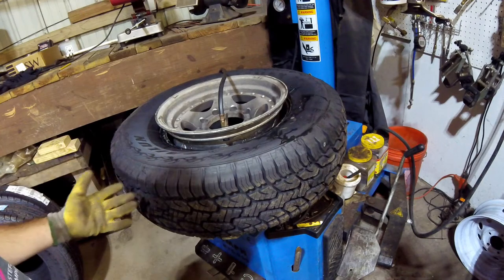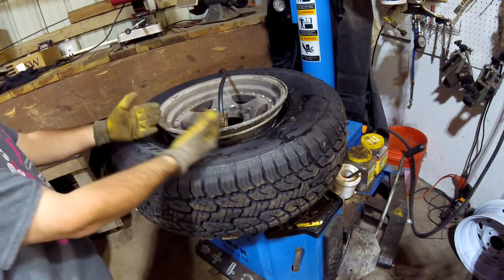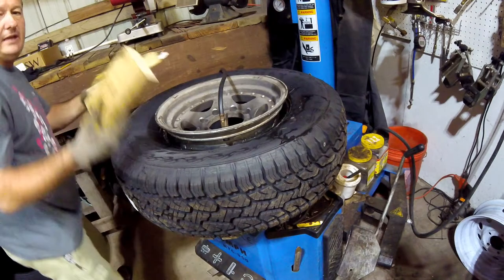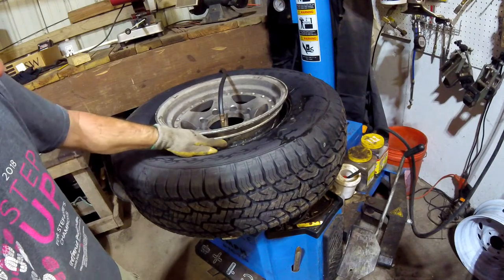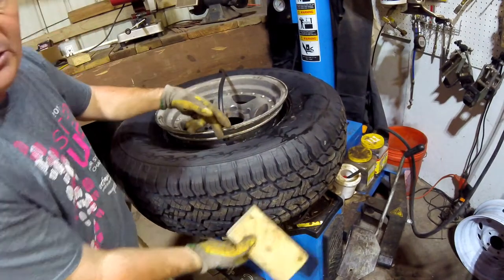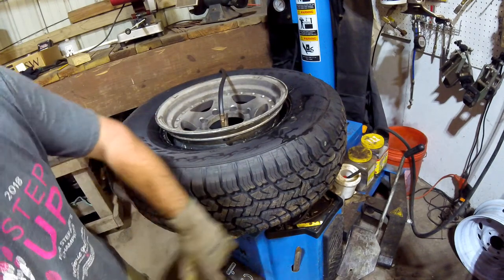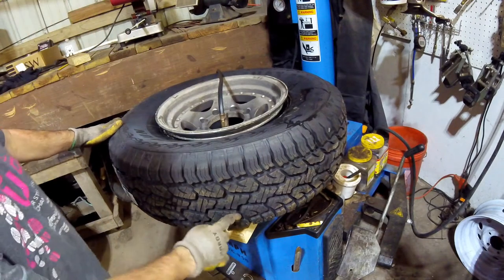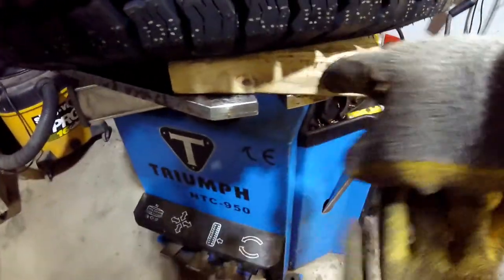The first thing I like to do in that situation is make sure the tire isn't sitting all the way down, because the gap is large and I want some air to come up through the bottom where the bead blaster works. I'll take some two-by-fours and put them underneath. The valve stem isn't even close to touching, so I like to get it up close to where the valve stem will also get air — getting air three ways: from the bottom, the valve stem, and the bead blaster tank.